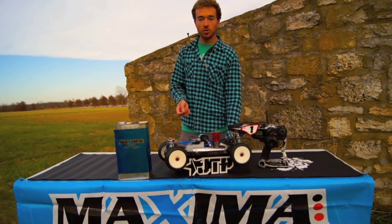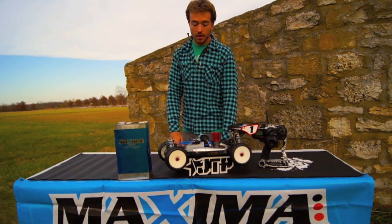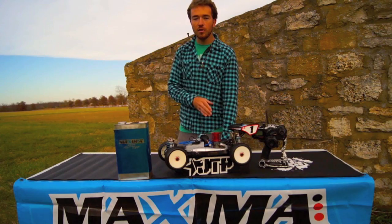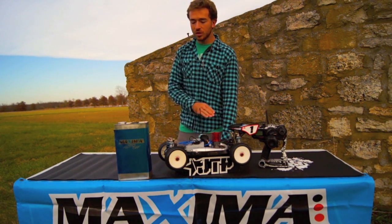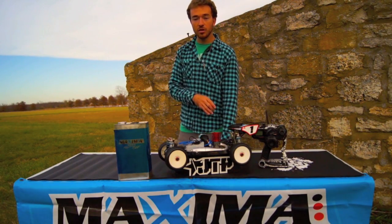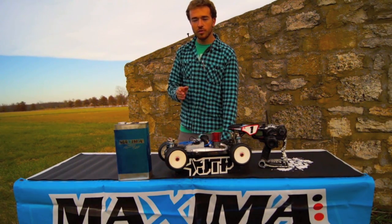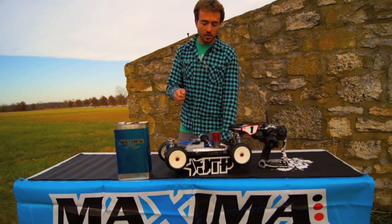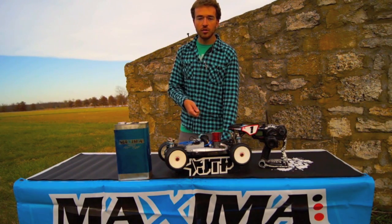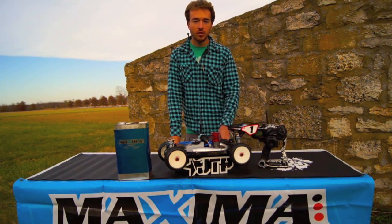If you're not too advanced, just go quarter turn at a time so you don't get your engine way too lean. You're going to want to look for about half throttle to full throttle — the engine starting to clean out. Once it's cleaning out pretty well, it's not going to clean out good on the bottom end because it's still going to be rich. But from about half throttle to full throttle, once that's cleaning out good, you're going to want to go down to the bottom end. Since you've leaned your top end a little bit, you're going to want to turn your idle down just a little bit, because as you lean your engine out your idle will raise. So then you're going to take your attention to the bottom end needle.